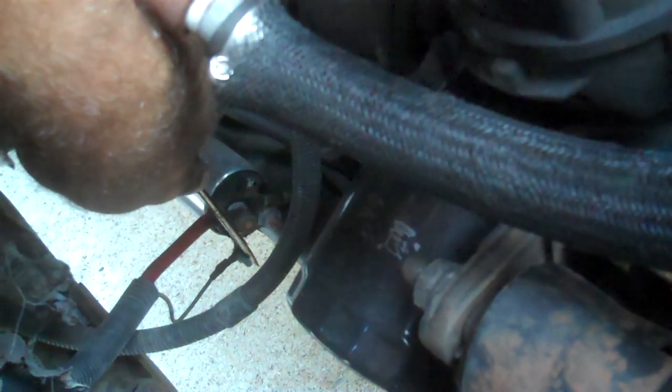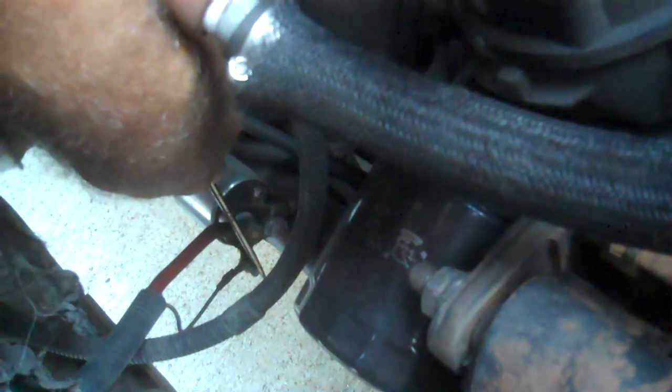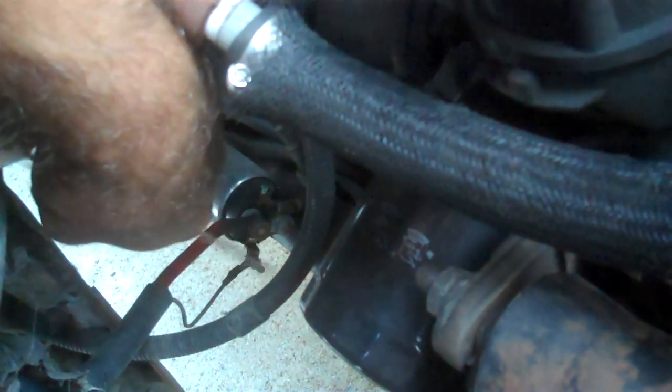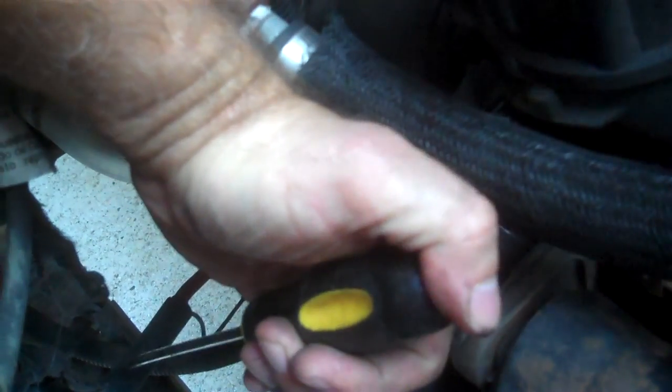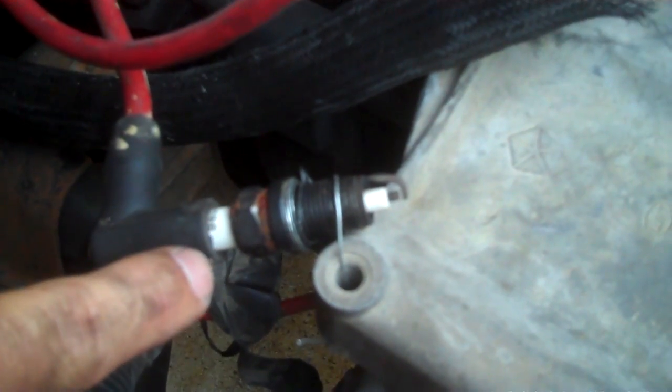You can also buy one of those little button contraptions - you put your alligator clip here and alligator clip here and push a little button to spin the motor over - that's one option. Whenever I spun the motor over I did not get a spark because I did not have the ignition on, so I'm going to turn the ignition on now.